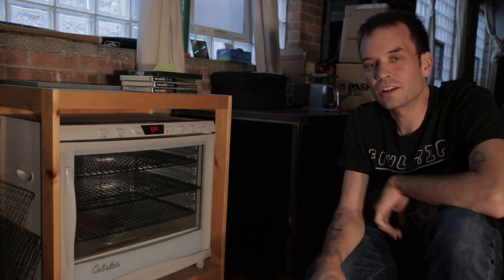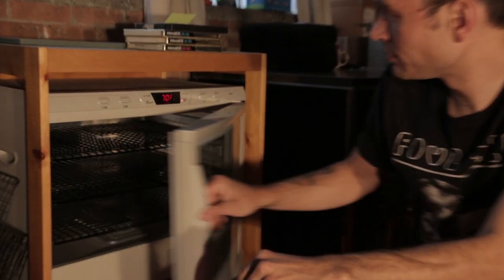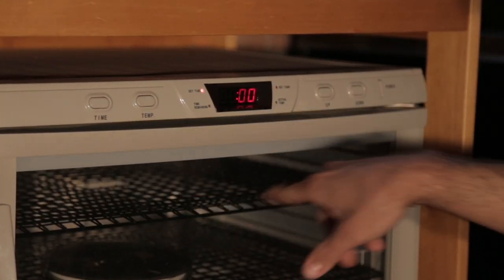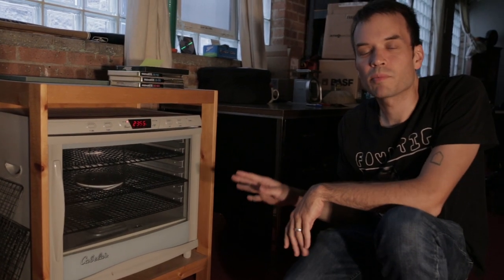Once you've determined that your tape needs baking, you have to find an oven that's suitable for baking tape specifically — do not use a conventional oven. At Electrical Audio we use a food dehydrator, which is suitable for a couple of good reasons: it can operate at a low temperature, way lower than a conventional oven, and it keeps the air inside circulating to maintain a consistent temperature throughout. Our first bake is always for 24 hours at 130 degrees. Load your tape up, set the temperature and the time, and after the 24 hours of baking, let your tape rest for another full 24 hours before putting it up on a machine for transfer.